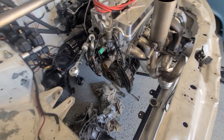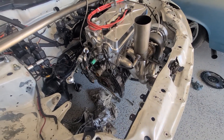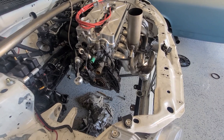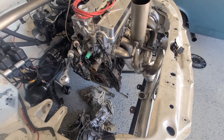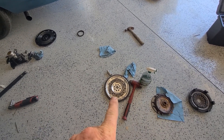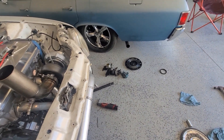On this new motor I pulled the rear main seal out and it was an OEM rear main seal from like a '95 or '98 GSR. I think maybe that rear main seal was just old and dry. I put this new one in and went ahead and pushed it back as far as I could, then siliconed it in four corners to hold it in place. We're going to go ahead and stick this old flywheel back on. When talking with Clutch Masters, they said this one does not take a spacer behind the flywheel. So maybe I was wrong. Also picked up a new pilot bearing because this one was trash.